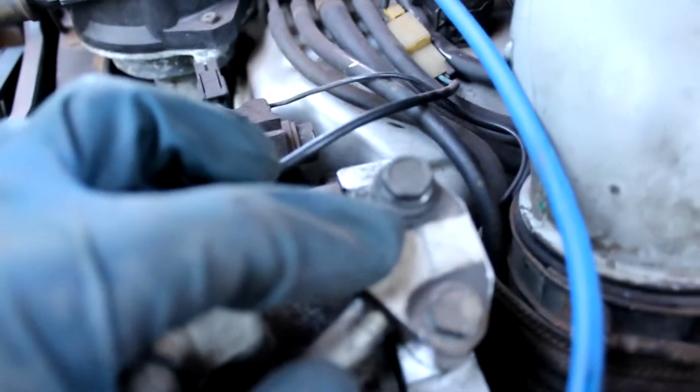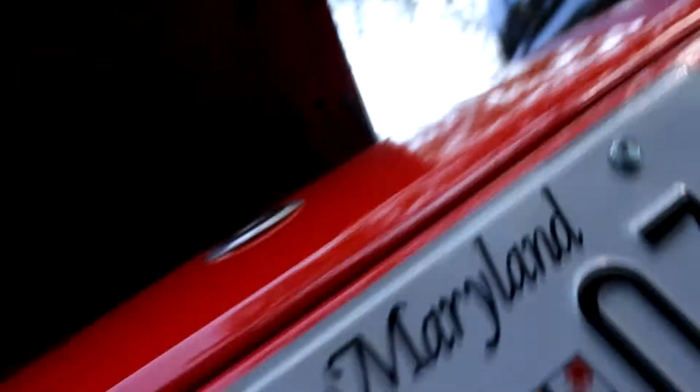Alright guys, as it gets later and later, I ended up putting the O-ring in this one right here. This is the one I was leaking before, but it did stop the leak with the regular O-ring, but I put an O-ring that is supplied right here. These little green ones, you can pick them up at any store. Those are actually made for AC units, and they come in the perfect size. So I put one in here, and then I put one in here, right here, and I cleaned off these threads just as much as I could.